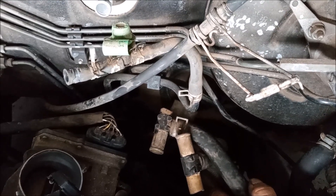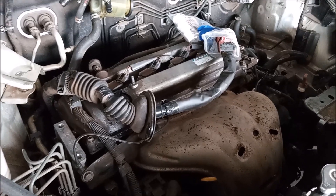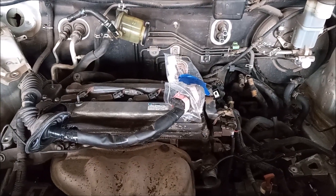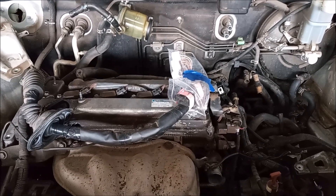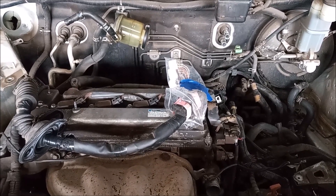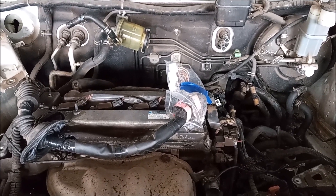unless they're monitoring their temperature gauge very closely, it's too late. And particularly on this 2AZ-FE engine, which is susceptible to the head lift problem, the engine is done for once it overheats. Thank you for watching this video. I hope it alerts you to this very important issue. Please take it seriously and check whether you have these hoses present for the rear heater core. If you do, replace the plastic pieces with new ones that are less likely to fail.